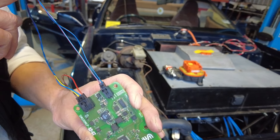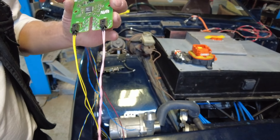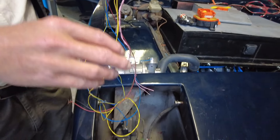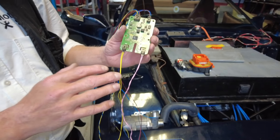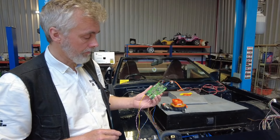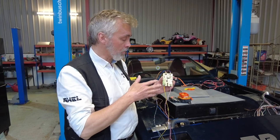We've got two wires that go to two separate places on the chassis to get our ground reference voltage, and that's really important. We've got two wires off the positive and off the negative side, which we take on to two different places within the battery packs. So it will check that the positive wire and the negative wire have no connection whatsoever with the chassis. And that's basically the isolation — it's there to stop me getting electrocuted. So it's continuous monitoring; all the time the ignition's switched on, this is working.